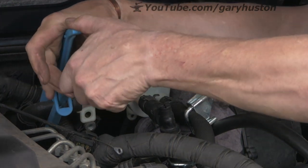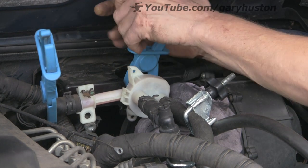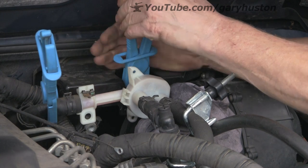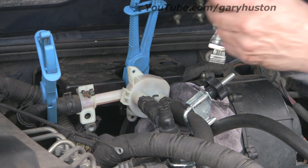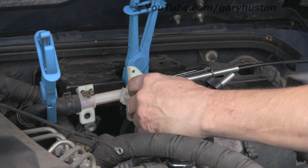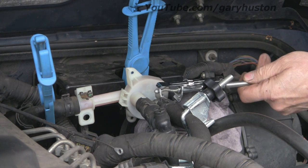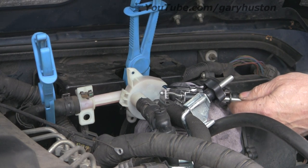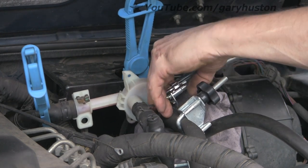That one is a little bit close to the pipe — I've not got enough room to shift the clamp. Same with this one. So this is where the handy little tool comes in. You simply open it up, put it over the clip, pull the handle and it locks — so you don't have to hold it. You can leave it locked, slide it off and go around and do all of them. I used it on the turbo hoses and the thermostat — it just makes life so much easier.